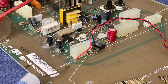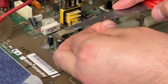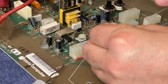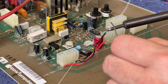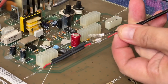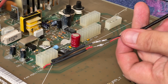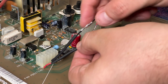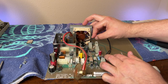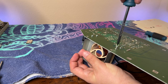Since my soldering iron is so used and abused, instead of trying to get my new wires through the board I'm just going to trim these wires and install my fan with the wires already in place. I first stripped the ends of the wires — and looking back at this footage, don't do it like I am here, it looks dangerous. Don't worry, I'm a professional stripper. Next I tin the leads and slip on some heat shrink tubing before I connect the wires for good. I joined together the wires and with as much coffee as I drank today it went alright — not my best work but not the worst either. The connection is solid so I slid up the tubing and locked it into place. All that's left now is to mount the fan back into place. I held the fan in place and put back all four of the screws. The fan is now installed.